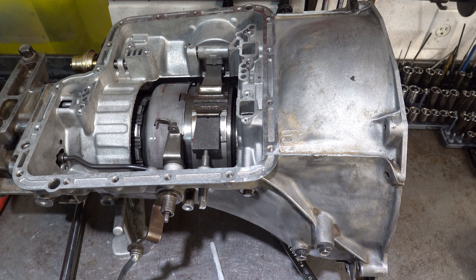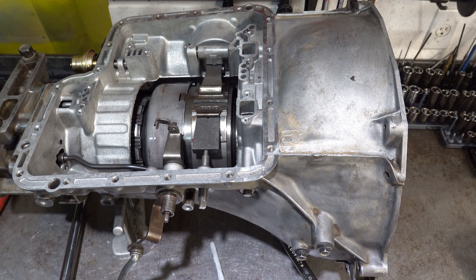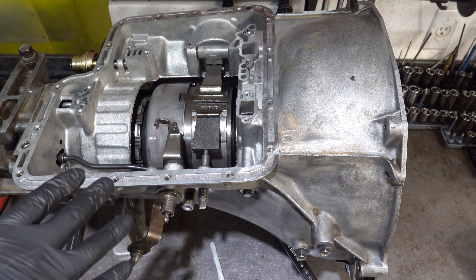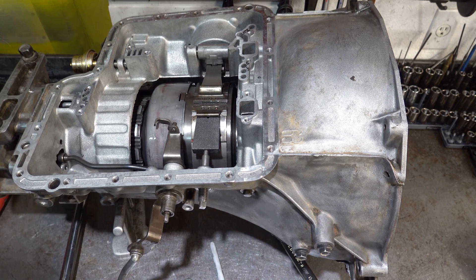Okay, it feels a little bit looser but I don't want to go any further than that, because once the transmission is in the vehicle and starts working, this is going to loosen up a little bit anyway - just like everything else in the transmission. You're going to get a little bit of additional clearance in all your clutch packs, assuming you soaked your frictions before doing your clutch clearance checks. You're going to get a little bit of expansion in play - we're talking like a couple thou here and there.